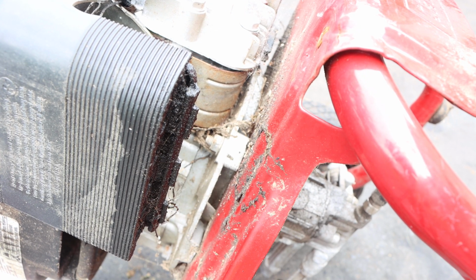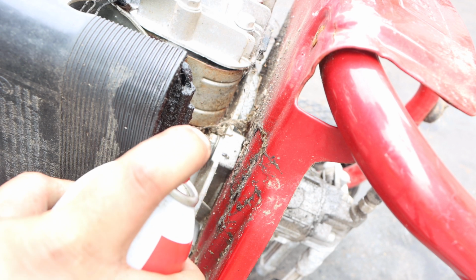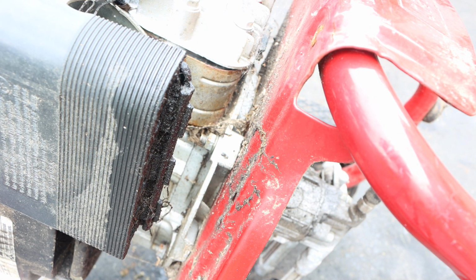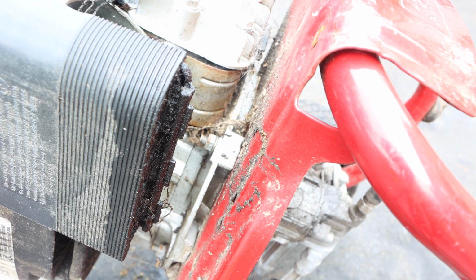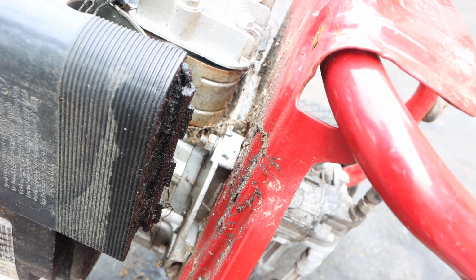Okay, so it's 3 bolts to literally remove this thing. It's Allen keys, it should be a 12mm, 10mm on top. As you guys can see, this is a pressure washer. It is stored outside. Unfortunately, you should not be storing yours outside at all. But it's been sitting for almost a year, 2 years. So I'm prepping the bolts with some WD-40, PB Blaster, any type of rust penetrant to make sure that this goes smoothly.